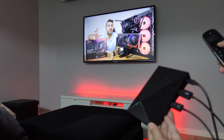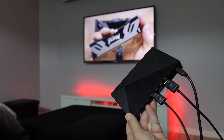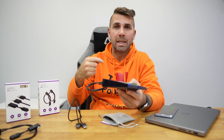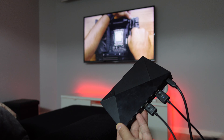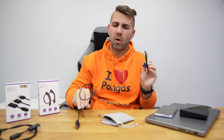One thing to keep in mind is that the performance is great. I did all sorts of tests in terms of audio synchronization, which is something these devices might have issues with, and we have seen in the past that some solutions were actually problems in this regard. In this particular case everything is just fine — video and audio were totally in sync. Video resolution is 1080p maximum, and I believe this is a limitation of the wireless technology; I wouldn't expect 4K yet, but 1080p is real and fluid. Of course the further away you get from the two units, you may lose signal. Links are in the description with full specifications including distance limitations.